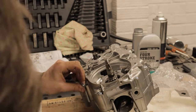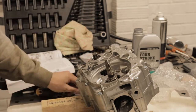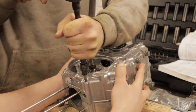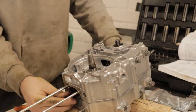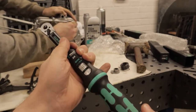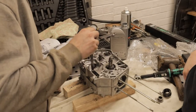You get that together with new bolts. I've got new bolts all round for this - I've had the cases done, I could have refurbished the old ones but I thought let's get some new hardware in it, fresh bolts all round, it makes a big difference. So with the bolts on the table we start working our way around the engine just making sure we work out where each length goes. In hindsight I should have really marked out the different lengths for each area of the engine, but we work it out and we start to tighten down these bolts, working our way around the case making sure that we evenly apply pressure so we don't warp the case or pinch the gasket in any funny way. I can really recommend a smaller torque wrench like this for these small engines - I also have a larger one but you'd never get the low torques that these smaller bolts require, so that is dead handy to have.